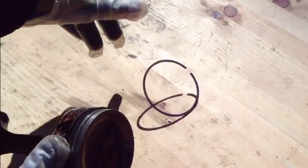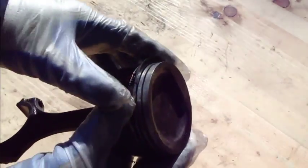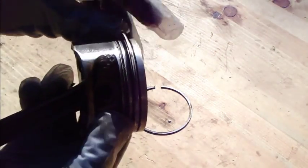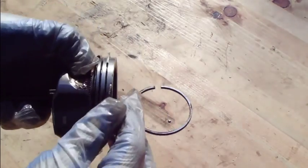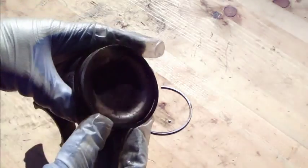And that was the first compression ring. Now the second compression ring — same technique. Press here on that side, and the ring comes up. Then I start to rotate. It's good to sometimes rotate it to the next groove position, and then take it away. You can also move the second ring in this direction, and then carefully remove it.